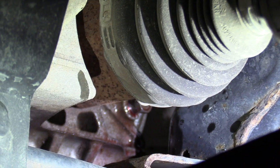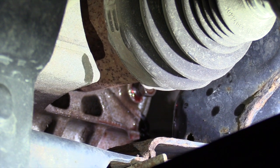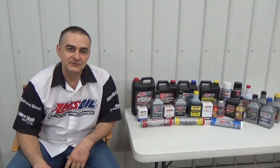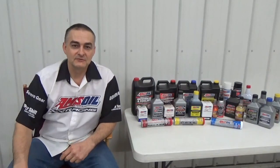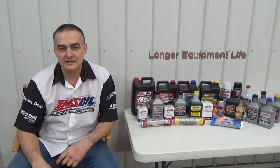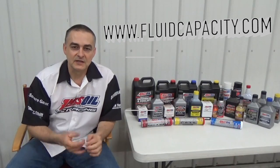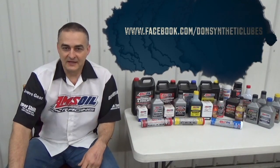Okay, shut it off. So that's it — we used just over 9 quarts, about 9.2 quarts, so we got pretty much all that fluid changed out. We're going to tighten up that plug and torque it down — 106 inch pounds is what it gets. Thanks for watching. Be sure to check out my other videos and subscribe to my channel at youtube.com/c/DonsOil. I'd like to introduce you to AMSOIL Synthetic Lubricants — the most complete line of synthetic lubricants on the market, offering greatly reduced wear, extended drain intervals, and longer equipment life. Check that out at donsoil.com. I also have a website for looking up fluid capacity at fluidcapacity.com — you can print off the capacity for your engine oil, cooling system, transmission, transfer case, and differentials. Be sure to like us on Facebook at facebook.com/DonSyntheticLubes. Thank you and have a great day.